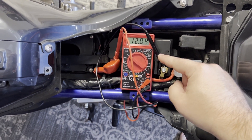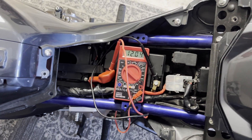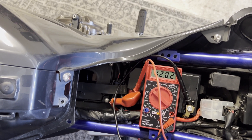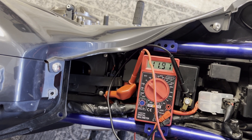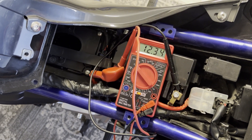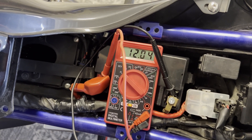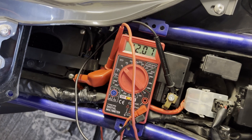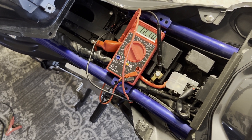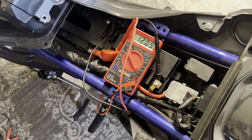I'm going to turn my voltmeter on — you can see the battery sitting around 12.04 volts right now. I didn't have it on the charger while I was gone, but I'm going to go ahead and fire up the bike really briefly because the garage door is closed, and you're going to see what happens. The bike should charge to around 13, 13.2 volts — just take a look at this. You can see it dropped because the bike's powered on; that's normal. So briefly what you saw there is it looked like it was charging normally, but all of a sudden the voltage started to drop, and that's not good. The voltage dropped back to around 12 volts again, and then when I revved the bike, it actually dipped into the high 11s.